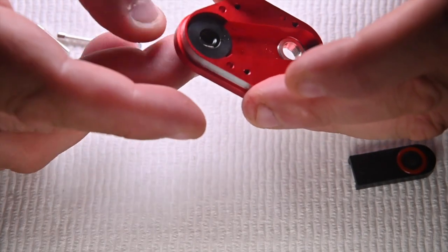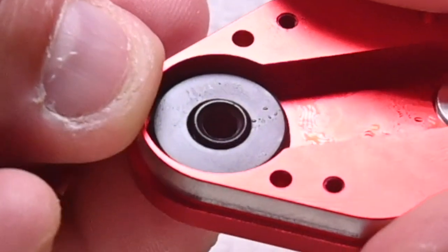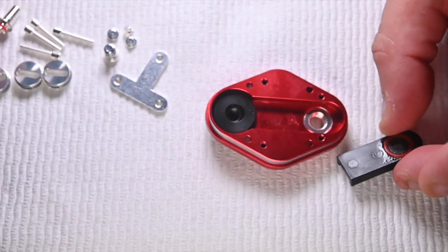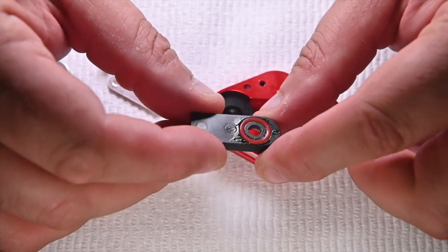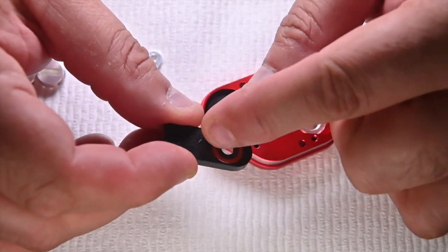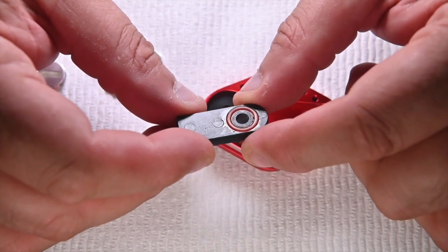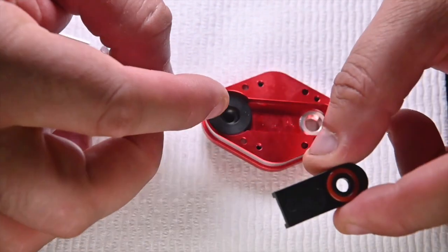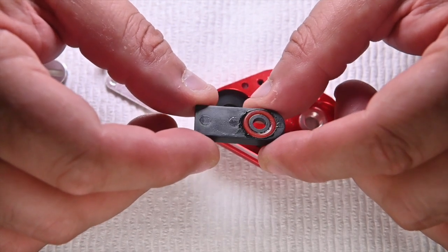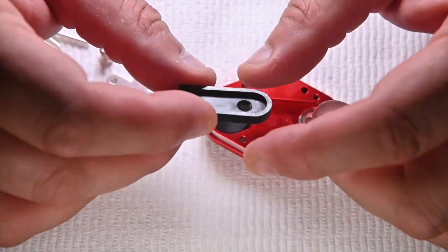Take my button and place it underneath with the spring. This is a non-conductive button. You can see. Now when you put this piece back on, you want the O-ring on this side facing the 510. This O-ring prevents any leakage spilling on your juice bottle and tries to prevent the liquid from getting into your device. Now as you saw my device, I'm an over dripper. I have a tendency to over drip and over squonk sometimes, where there's only so much these O-rings could do, basically, so liquid just comes bursting out.